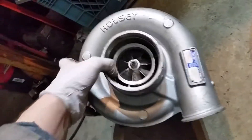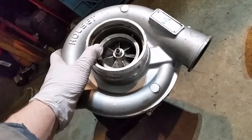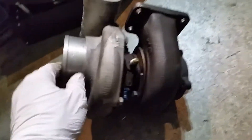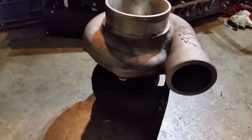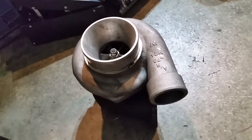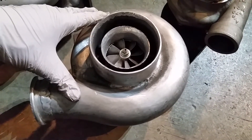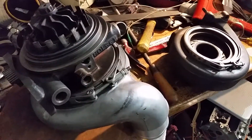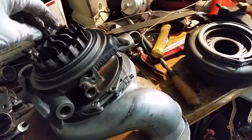This compressor is massive — these go on 12-liter diesel Volvo semi trucks. And this, at only 16 pounds, is a ball bearing GT35R from Garrett. That would have been fun — not very high horsepower but boost right off the line all the time. The HX40 was awesome; it did not seem very laggy. So this is going to be a hopefully close-to-no-lag version of the HX40, and we'll see how that goes once I can actually get it going.